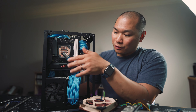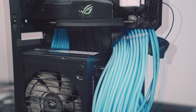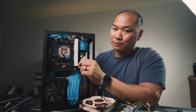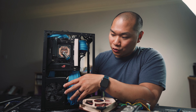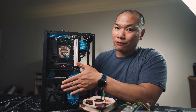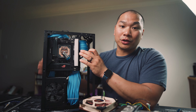That also means you need to have an SFX or SFXL power supply only, because you don't have the thickness for an ATX unit. For custom cooling, I would double down on the recommendation to go for an SFX unit because you're going to want every bit of space. This fan also pretty much has to face out now because there's no way to turn it in and you don't have the clearance to offset it. You'll want to use the mesh panel over this side for ventilation. On the other side, that GPU block is going to be completely covering the fan, which is not a good configuration.